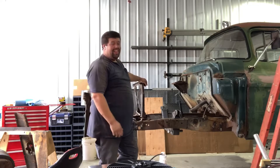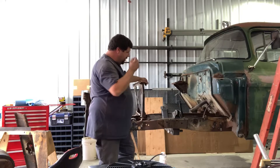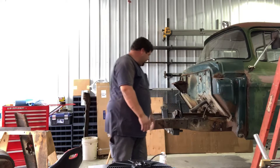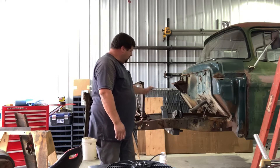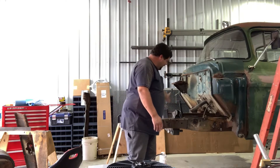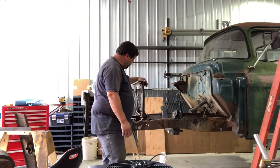We are having fun today. We're running into a little difficulty with our front suspension. We tacked our IFS Air Ride into place and when we looked at where our motor mounts are going to come, one of our front motor mounts comes right here. I could move it forward but we don't have enough room then to put our radiator in behind our core support.